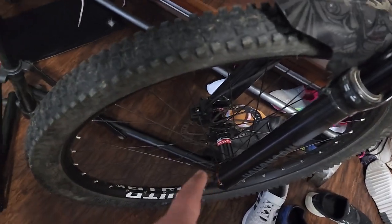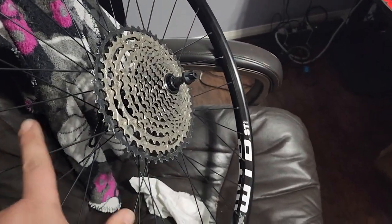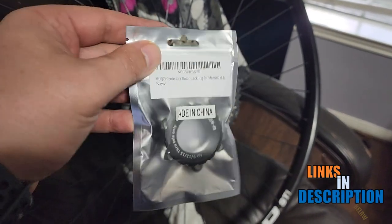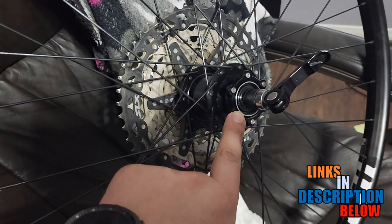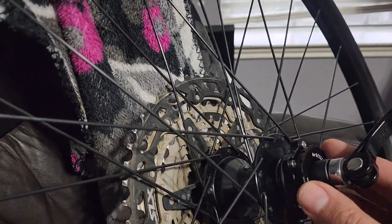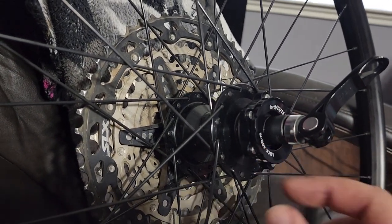This new wheel has Shimano with micro spline while the other has Novatec. Since I didn't want to buy new brakes, I got a six-bolt adapter. It goes right here, then you put the six-bolt rotor on it. There's a little bevel so it sits flush, then you come back with the lock ring and cap it in — locked with the bottom bracket tool at 40 Newton meters.